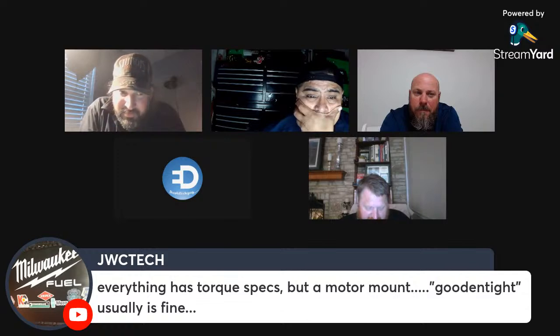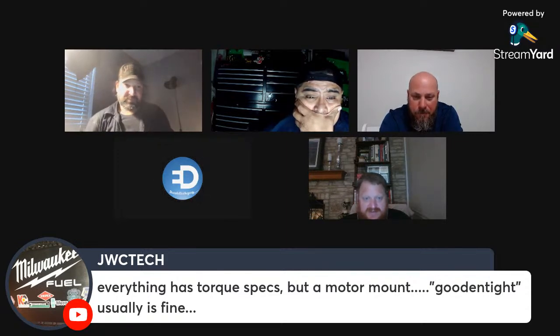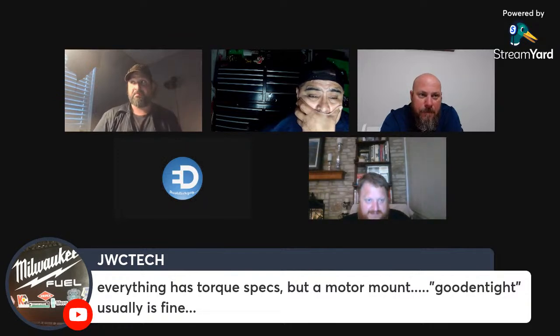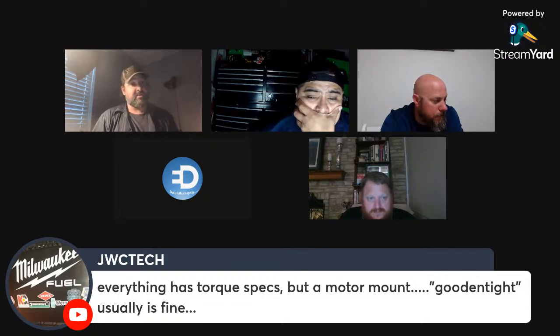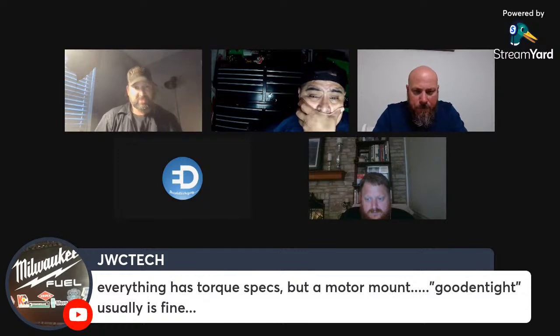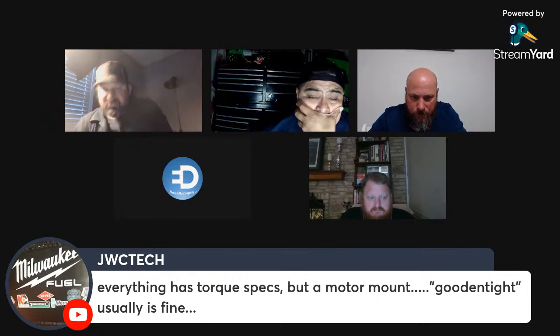I double and triple check myself all the time. It's not that I don't trust myself, it's that you never know what happens. You don't know if parts fail. Did you forget a bolt? Yeah, I did that today. Absolutely. 480 high voltage wiring. Double check, because at the end of the day, when I leave, someone else has to hit the switch and make sure that motor runs or that cabinet runs or something is done correctly. It's very scary. One time I did a really crappy job and treated a high voltage cable like a regular cable and forgot about the shielding. It shot a 480 volt arc up to the ceiling of the roof and almost fried a customer's motor. Never made that mistake again.